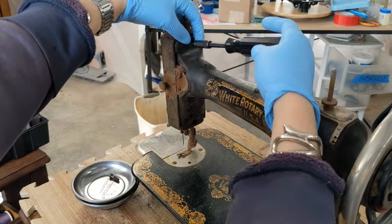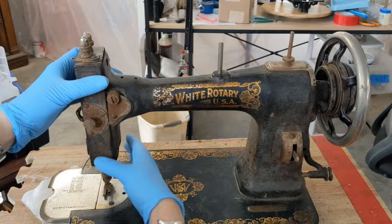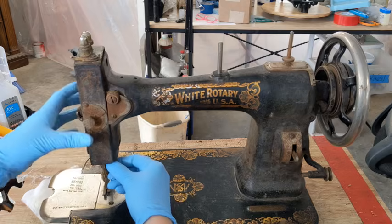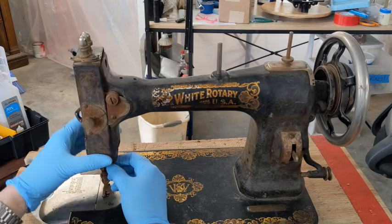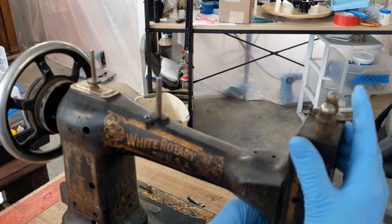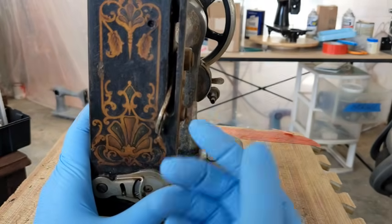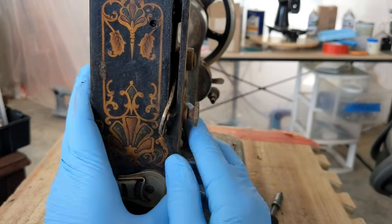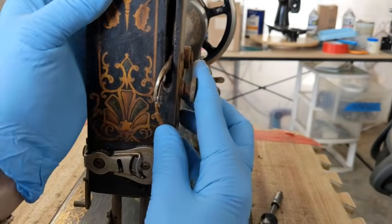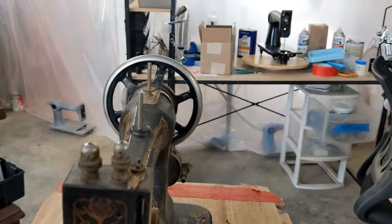The only other white rotary I think I have on my channel is actually a Florence rotary, which is a version of a white rotary. And that was one that I completely disassembled and painted pink a while back. You know what, I'm gonna wiggle. There's something else holding you on. Hang on. Show you, see this? Thread take-up lever, it's bent. It is completely bent in sideways. So that's kind of holding it on there. I don't even know what I'm going to run into inside, but I can tell I'm going to have to bend that back out. Okay, so let me lift you up.